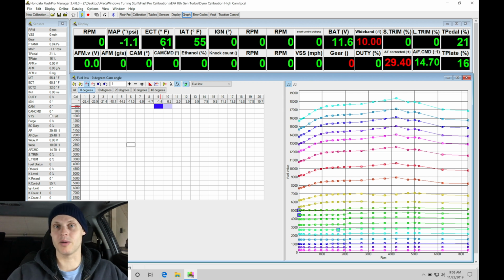So we need to ramp up how much fuel we're actually adding in. Generally speaking, it's another maybe 30–40% to allow the engine to have a reasonable air fuel and be able to warm up properly. Now, once we get up to operating temperature, all of the warm-up enrichments are going to phase out essentially, and we're going to be operating here just on the values that we programmed in our table.